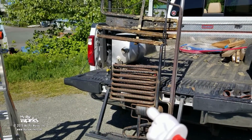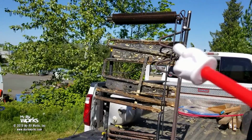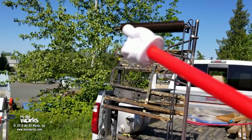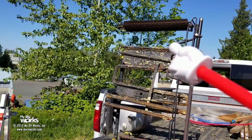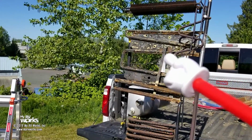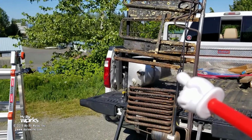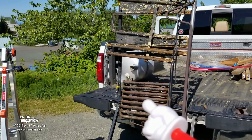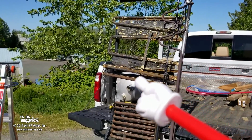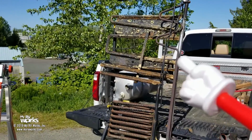The water, again, story of ammonia. Ammonia was a liquid. Now the ammonia is a vapor. We want the ammonia to go back to a liquid here, so we're going to get that cooled back down. Now the ammonia is a liquid. By the time it gets back up in here, it's going to go back to a vapor. It's going to evaporate. And this is where the hydrogen part is. We're jumping ahead, and then the ammonia is going to come back down here, become a liquid again. So the ammonia goes from liquid to vapor to liquid to vapor. So in one loop, the ammonia goes liquid, vapor, liquid, vapor.